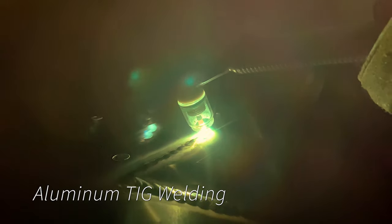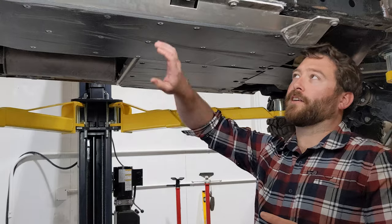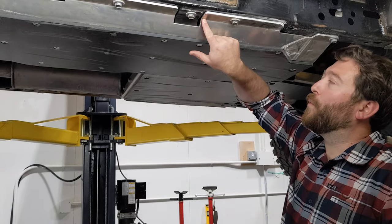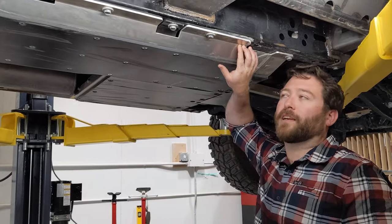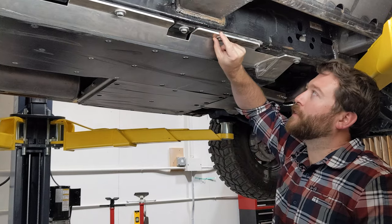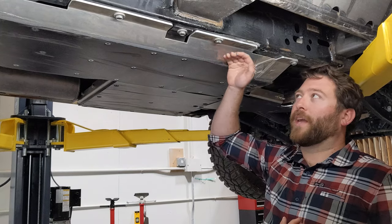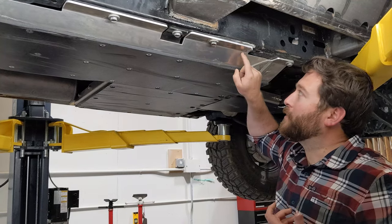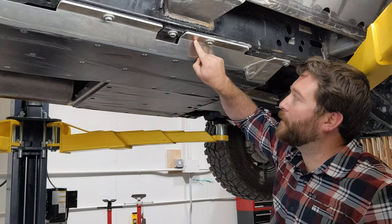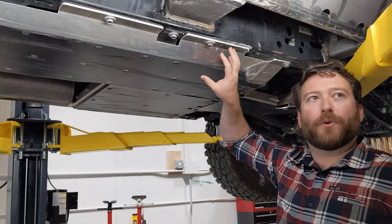you'll lose anywhere from 50 to 58% of your strength in those welded areas. That is why you're going to see so many formed flanges on this system. Comparing this to your factory skid — there's quite a bit of difference in the length of the flanges we've gone with. We really like to make these flanges as long as we can. It gives you a lot more surface area that engages with the frame rail, which is ideal because you're going to be transferring a lot of your impacts and weight up to your frame rail through the metal. The factory skids only have this little tiny pocket, pretty much enough to wrap around where the bolt hole and mounting point is.